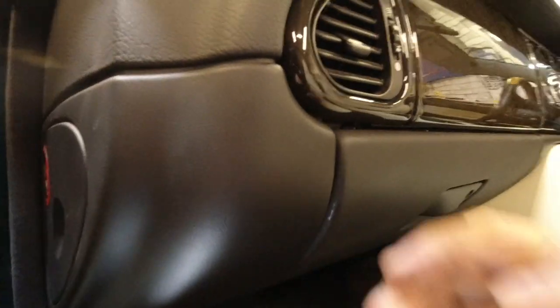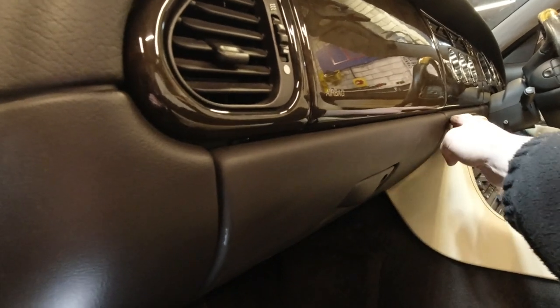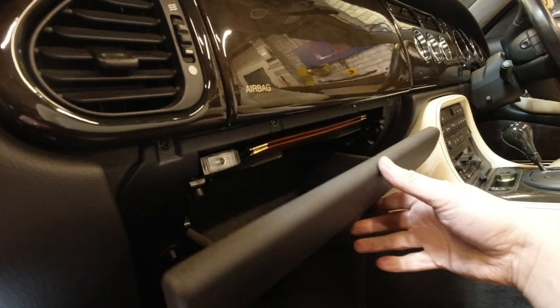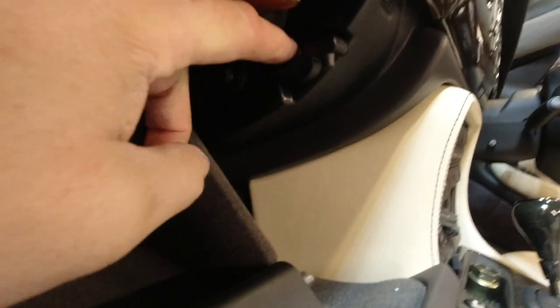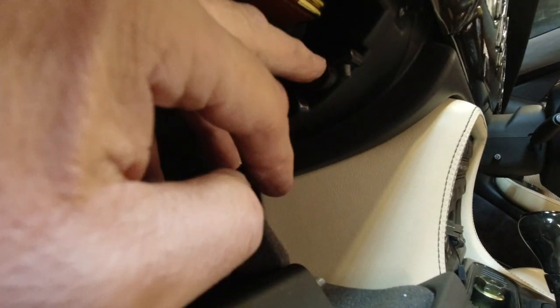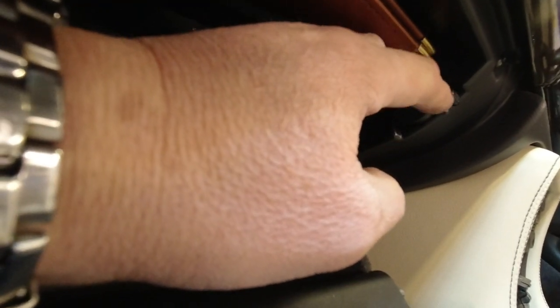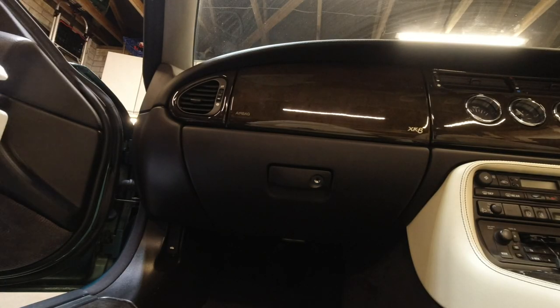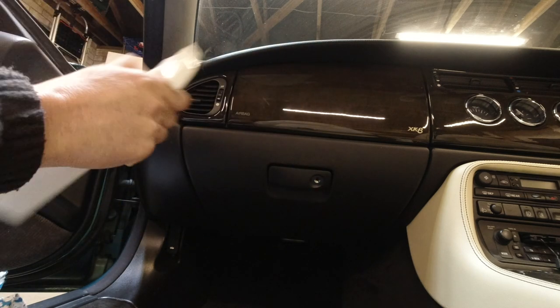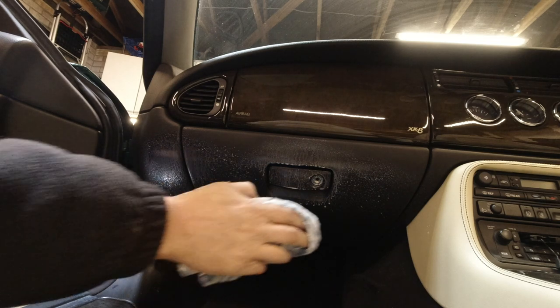Our very last secret connected with the glove box is finessing the fit. Mine I don't need to adjust at all, but let's imagine this edge was a little forward of the dashboard — how would I adjust that? All we do is open the glove box door, loosen off this bolt here and you can rotate this so that you get a different clamping position. This little buffer stops the door, and the bolt — the thing we've been fixing — fits behind here, so you can adjust everything about this by rotating that little clamp just a few degrees.